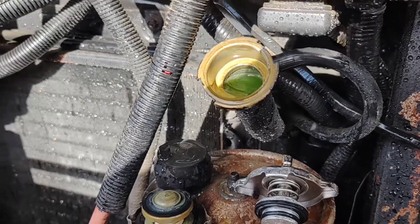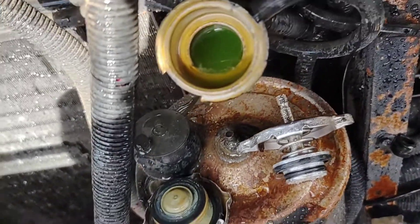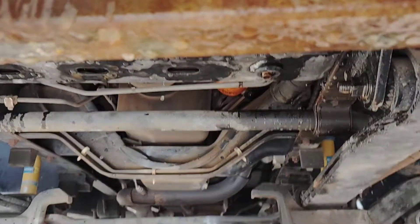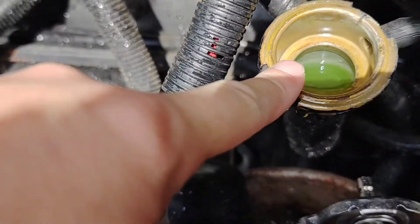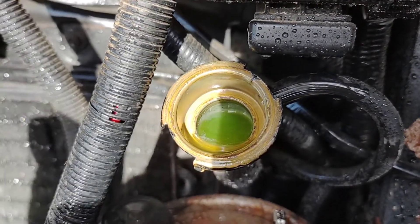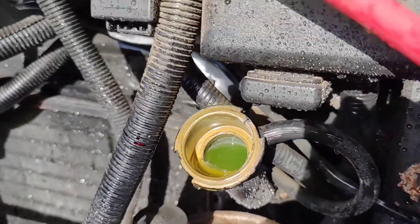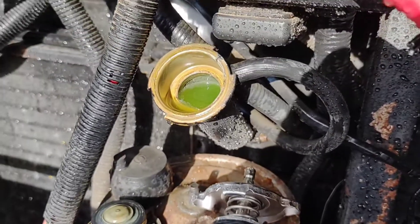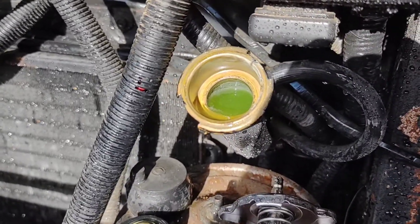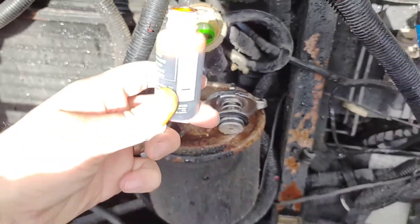We're back out at the RV. As an added precaution, I went ahead and cleaned everything off with fresh water, sprayed down under the hood so there's no residual coolant. Hopefully after we put the coolant dye in, we won't see any green dye dripping on the outside — it should all be clean. I'm going to put the dye in, put the pressure cap back on, attach the pressure tester, start the engine, and run it for two or three minutes to circulate it through the entire cooling system, then go hunting for any dye leaks.